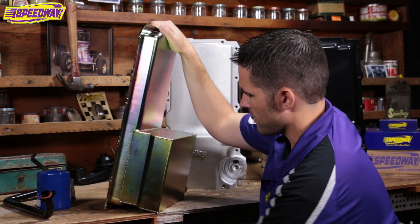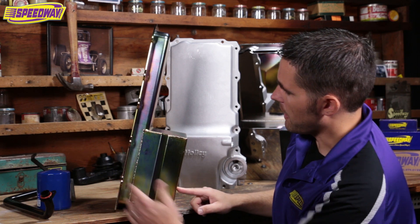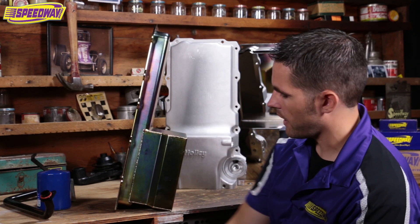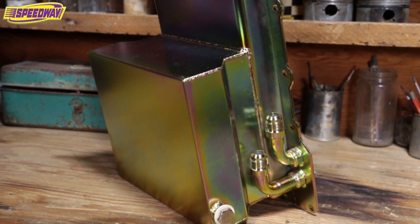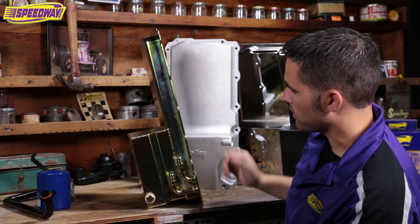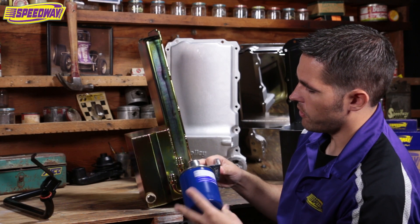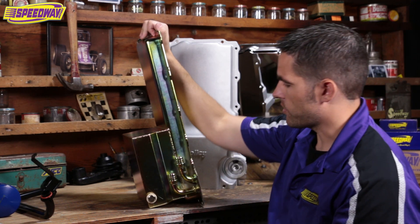This pan holds seven quarts of oil — the Holley pan was about five — so this will hold more. From lip to bottom of sump is almost six inches, just a little bit taller than the Holley. It's 11 and three-quarter inches from here to the front of the motor, and the width here is an inch and five-eighths, so it's a little skinnier in case you're having issues getting the motor sandwiched in. This pan doesn't come with a spot for the oil filter like the Holley pan, so you'd need to buy an oil filter relocation kit. We sell several versions — vertical or horizontal mounting — and it basically takes your stock GM oil filter and screws right on. There's a little bit of extra work, but the price difference is pretty great, so this is a great pan to use.